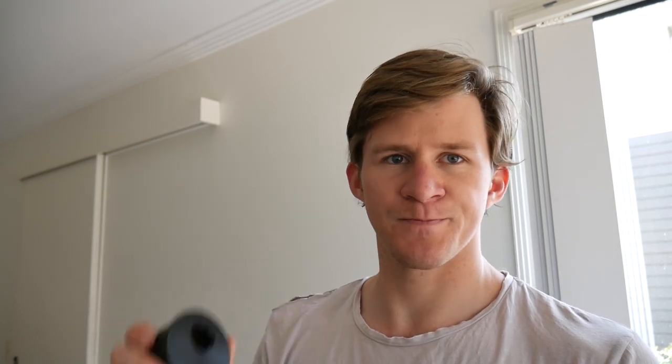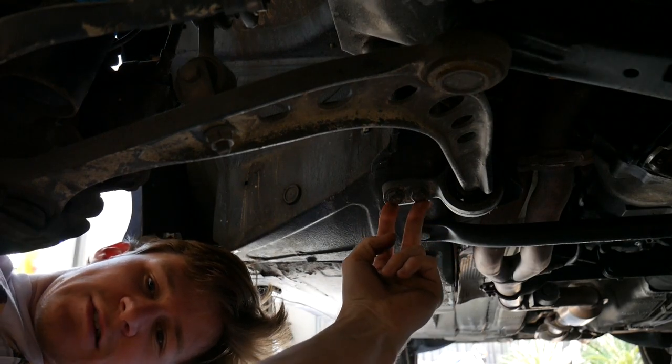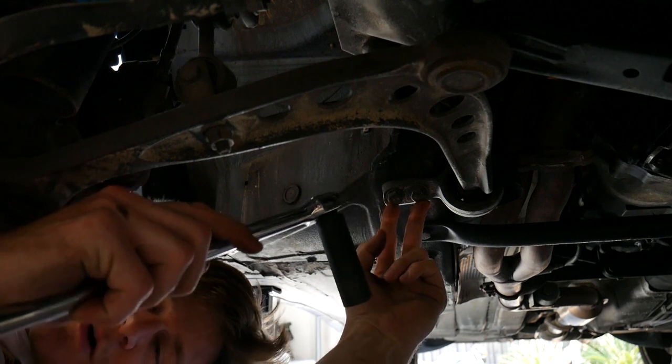If you're looking for better ride quality, go with OEM M3 bushings — the rubber ones. They have a large rubber portion that absorbs impacts like square edge hits. If not, these are perfect. For the two bolts here you'll need a 17, and probably a breaker bar as well.